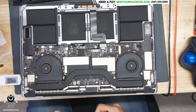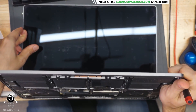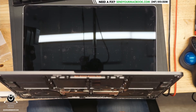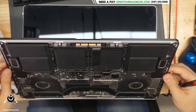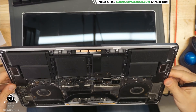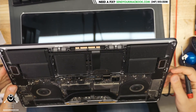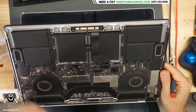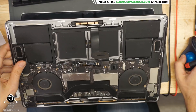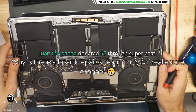The problem discussed with this computer is that it was stuck at 5 volts, 0 amps. And as you can see now, it is turning on, the fans are spinning, and most likely I am going to have a picture on the screen. You can see there's an Apple logo there. The backlight is off because I had the computer closed — I'll just reboot it and you'll be able to see. Yes, the reason this was not working is because somebody shoved a screw into a connector, which did not allow BIOS communication and/or may have been shorting SMC_RESET_L to ground. A connector is not a screw hole — a connector is a connector and a screw hole is a screw hole.